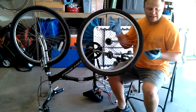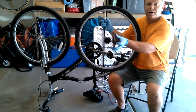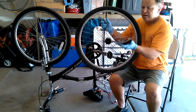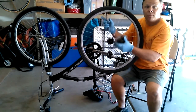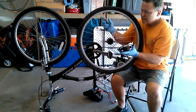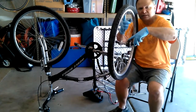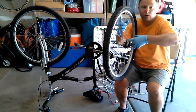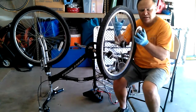In this segment we're going to talk about the wheel assembly. Your wheel has a gear on it that is threaded on the inside. You have to get a tool, or bring it to your bicycle shop, to have this gear removed. Once you remove this gear, it will allow you to put on the sprocket that came with the kit, which you will then screw on — also called a freewheel.